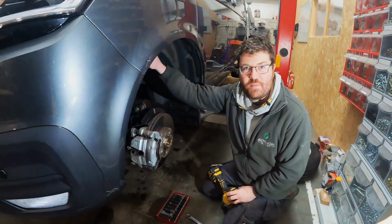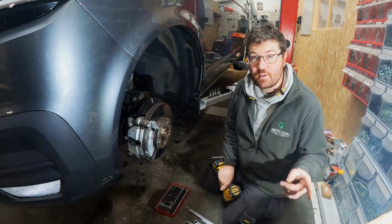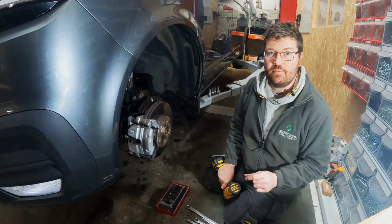In order to remove the suspension, you need a 21 spanner. Just be very, very careful because most socket sets do not have a 21. So just be mindful of this before you start this on a Saturday afternoon.